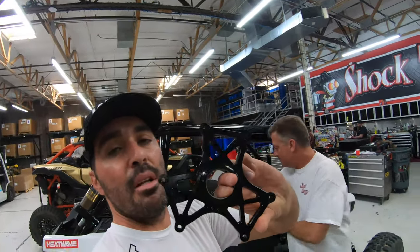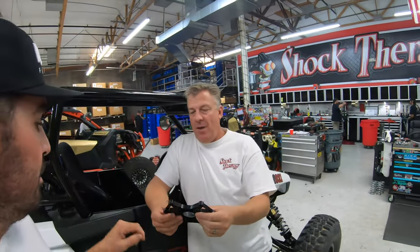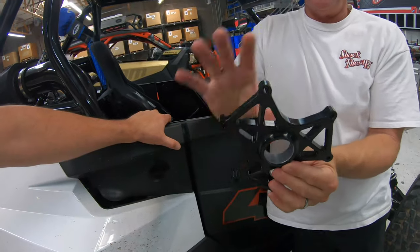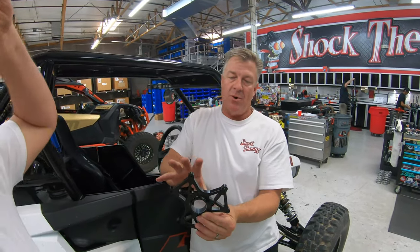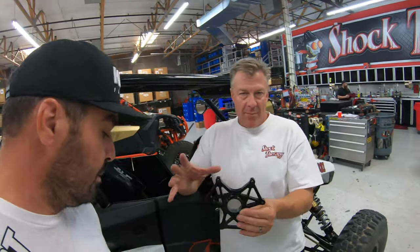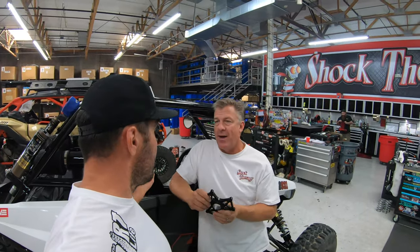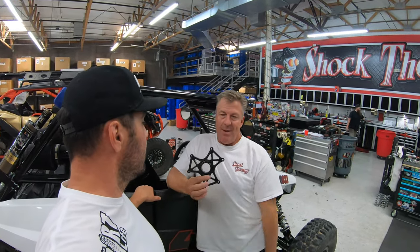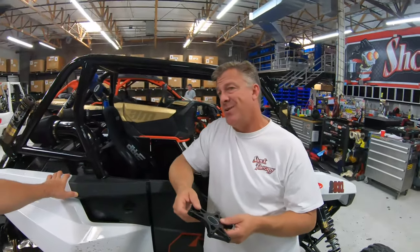Travis also provided a clutch cover — actually a pedestal or tower brace. On the clutch assembly there are three towers with sliders, rollers, and weights, and this brace ties them all together. They tend to spread apart, becoming a weak spot in the clutch and eventually causing belt failures. This isn't going to make you faster, but it will keep the clutch together longer and keep belt temps lower. If you have high belt temps, you slow down — and that's not good for racing.